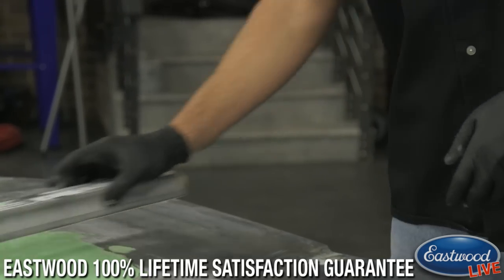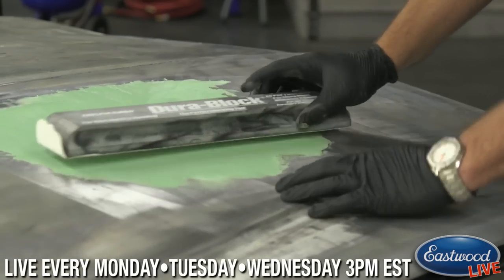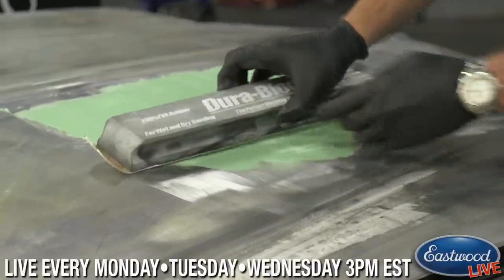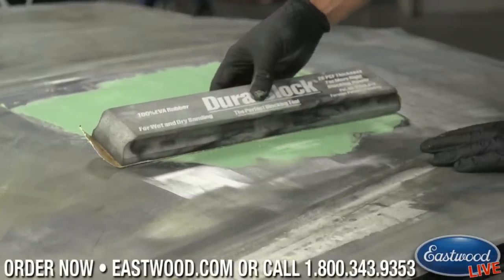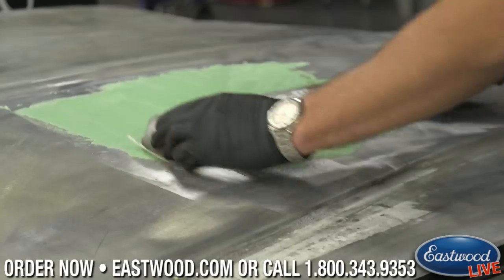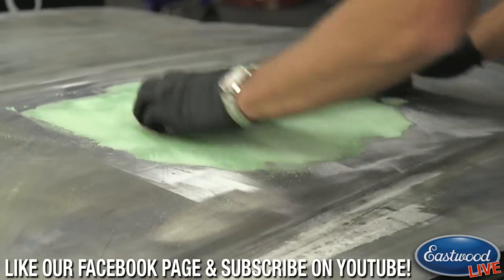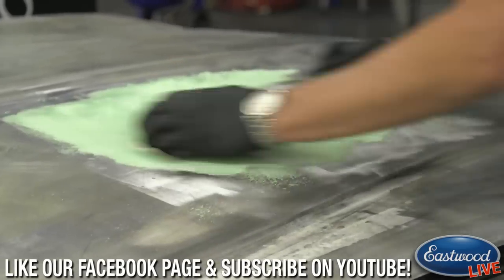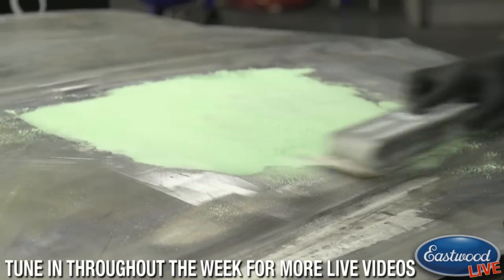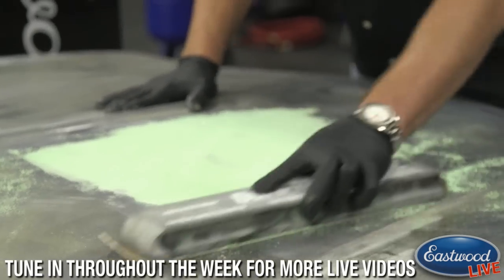While you're sanding, one of the tricks I always use is that you don't want to come straight side to side like this, because the edge of your sanding block is going to wind up digging in over and over again in the same spot. So you want to make an X pattern, sanding sideways and switching it up back and forth as you sand, to constantly make a new section. You can work your way across the panel, then flip and work the other way across the panel, and just keep going back and forth.